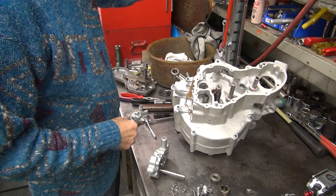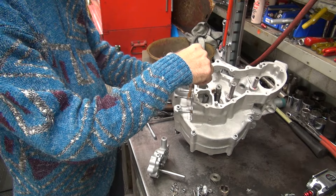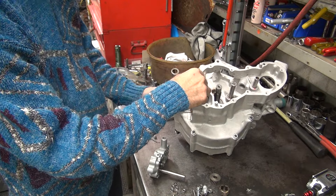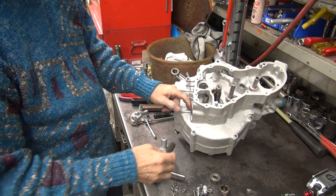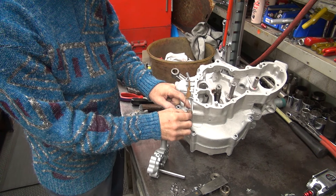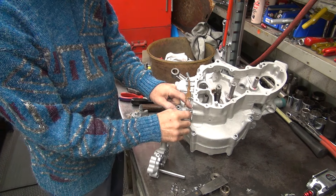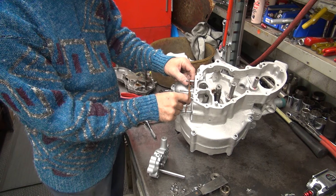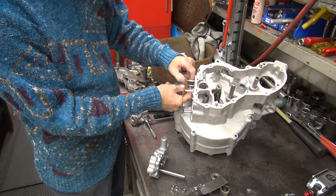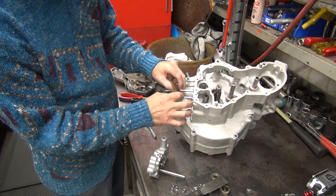I'm going to get this off without tearing it. Use a putty knife to help back it up so you don't tear things. It'd be a bitch to have to swap the gasket out after we get it all finally fitted. This bottom corner is the worst spot. Kind of pull the gasket this way here to get it to release itself. Whichever one is farthest in is the one you need to work out — when you start getting them off the studs it helps a lot. So whenever you can pull one off the stud, do it.